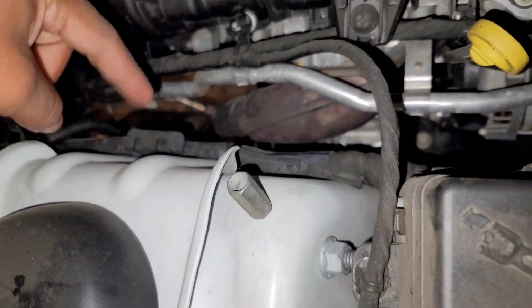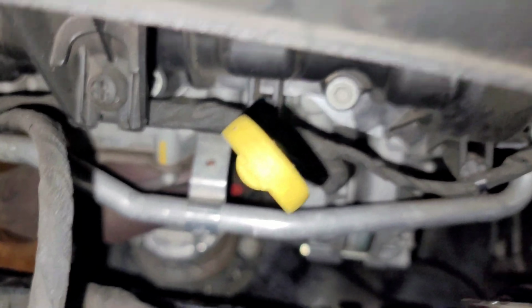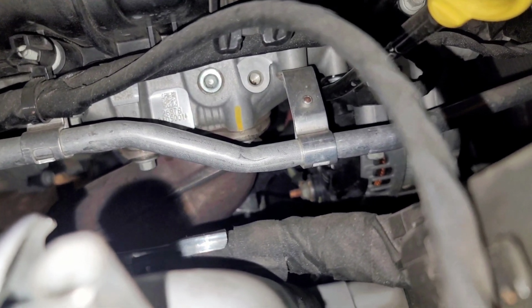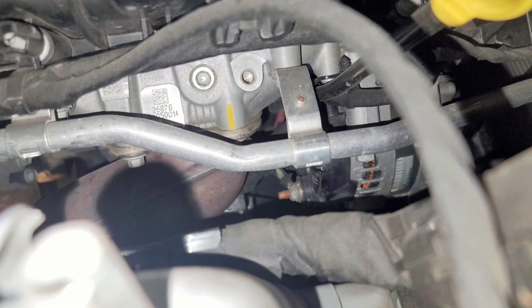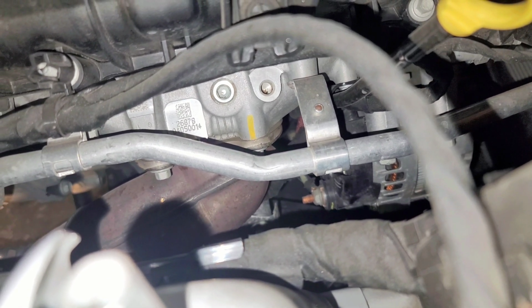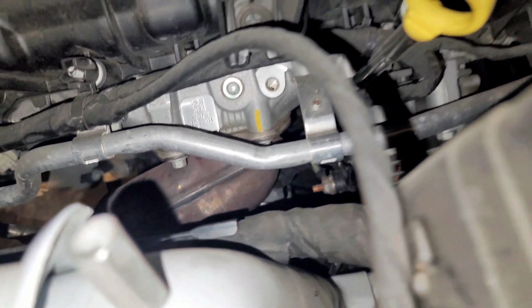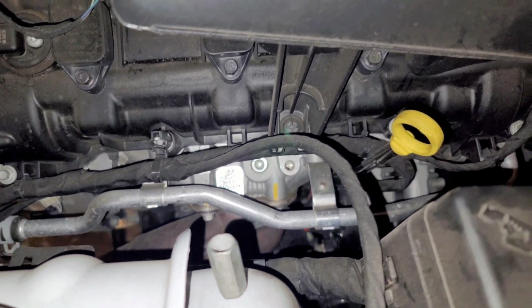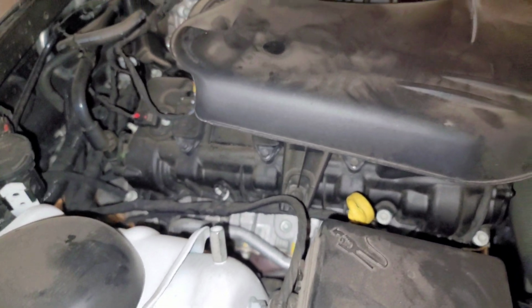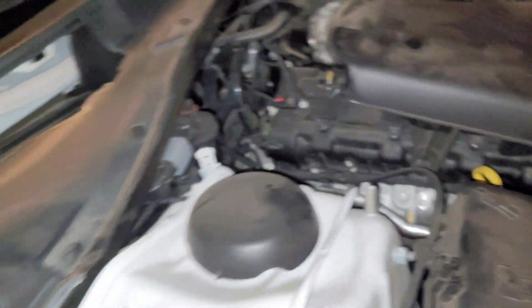Back somewhere up under here, somewhere. I don't know. And on the alternator, I don't know if you can see it, but that runs the same gauge wire. So when you're trying to charge your battery, it's like putting a bottleneck on it. It's not even getting its true power, so the alternator is not able to charge the battery correctly. That's the whole purpose of doing a big 3 upgrade. You just get that straight power, that 0 gauge wire. I'm going to run it all the way through here, straight to the alternator, so it charges my battery instantly, more efficiently, and a lot better.